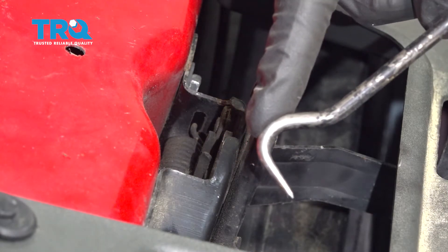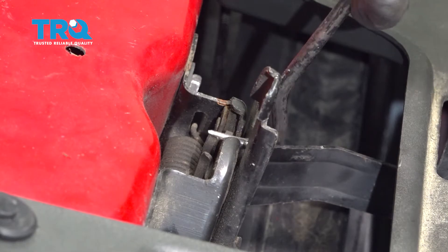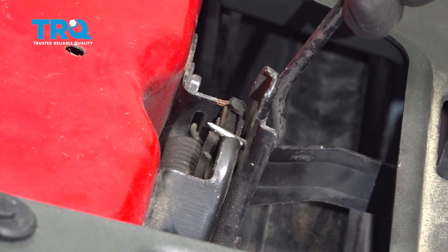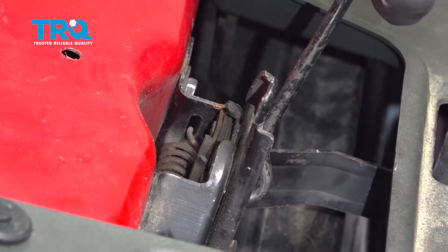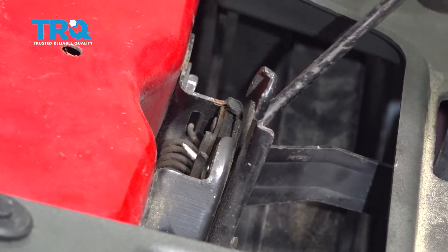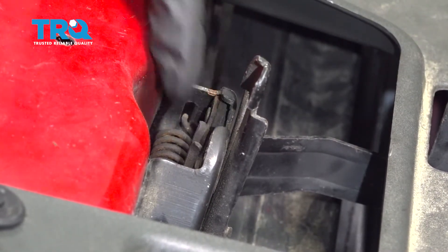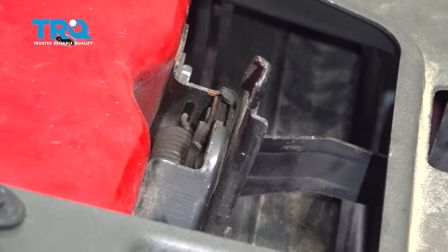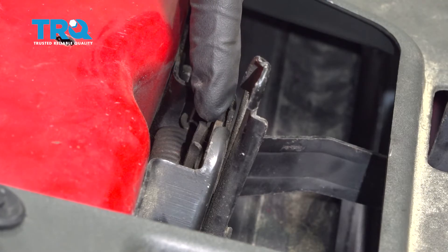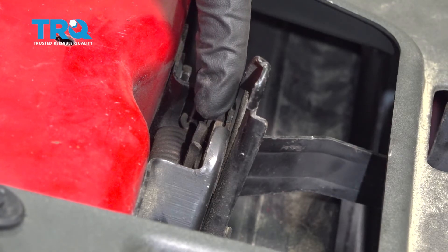To do that, I'm gonna use a 90-degree pick. Come in through the front and I'm gonna come right along this tab. Essentially I'm using the pick as if it's the hood. I'll press down the locking actuator here and at that point it's latched in — I can't lift this up. So we're gonna pay attention to this area. I'm gonna get inside the passenger compartment and I'm gonna pull on that handle. As you can tell, it released just as it was supposed to. Now I'm gonna go ahead and check it one last time, this time with the hood.